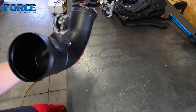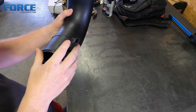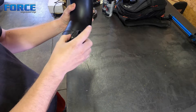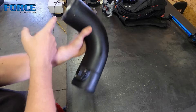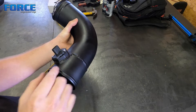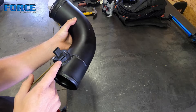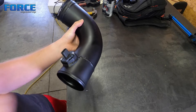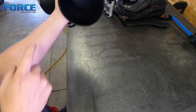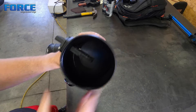While that thing's drying, I'll show you this. Originally, when this thing was still on the stock ECU, I had the mass air sensor here — charger inlet here, mass air sensor right there. The air was still turbulent through there so I couldn't use it as a sensor. I ended up having to do a draw-through MAF setup and a lot of other stuff. Anyway, this has just literally been in here to plug a hole for a really long time.